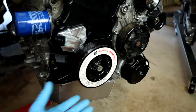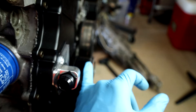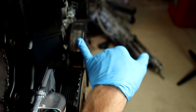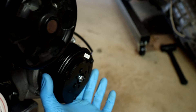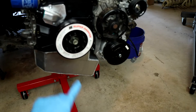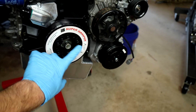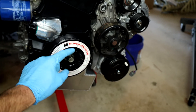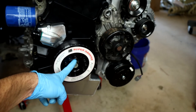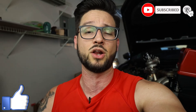And there it is - that's pretty much it. It's a relatively simple install. You can see that the ridges on the super damper line up with the flat section on the water pump, and the ridges also line up with the AC compressor, the alternator, and all the rest. I'll be replacing the crank pulley bolt with a new one and torquing it down to the correct spec, which I believe is 181 foot-pounds. That's going to wrap it up for this one - bit of a short video this week but I hope you enjoyed it. If you found it helpful, give it a thumbs up, subscribe to the channel to stay up to date on the build and the engine swap, and until next time, build your dreams.